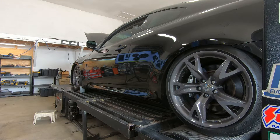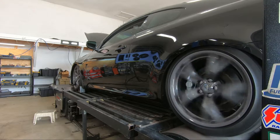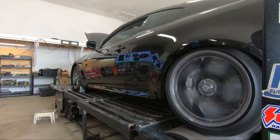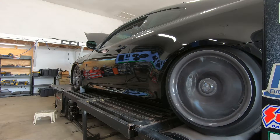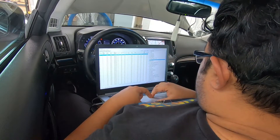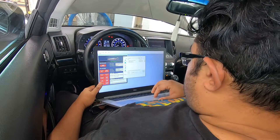I didn't really touch the timing yet — I think the timing is kind of up there from factory already. On this run the fueling was pretty good; it was doing 12.5 all the way through. A little bit up top it got a little richer, like high 11s. Still on stock timing for this run. I actually stopped at around 6500 RPMs, so I'm going to look at the data. I saw some rich spots which I'm going to correct, and I'm going to add a little bit of timing.